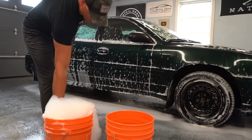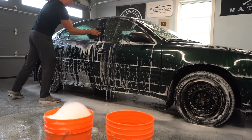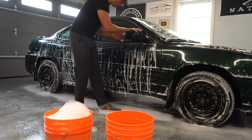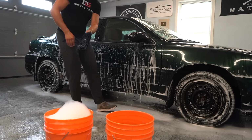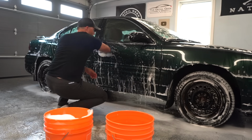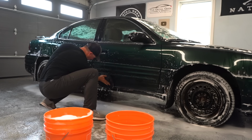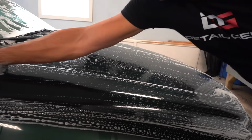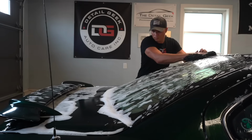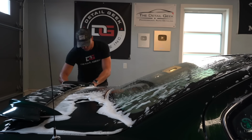Now, starting on the wash stage, and I figured I'd mention that I always use the two bucket method when washing a vehicle, which means having one bucket with soapy water and one bucket for rinsing my wash mitt. And I also have grit guards in the bottom of each bucket. If you aren't sure what those are, I've got links to them in the description for you. But basically, you want to use a nice, soft microfiber chenille wash mitt and go panel by panel, rinsing your mitt after each one. Of course, washing the vehicle top down. And if you follow those steps, you will greatly reduce the chance of instilling any swirl marks in the paint.